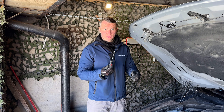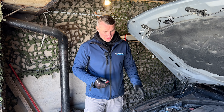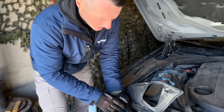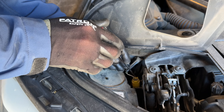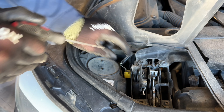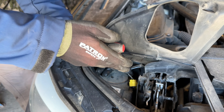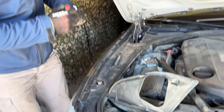Tools you'll need: gloves to protect your hands and a small screwdriver. The four pyrotechnic cartridges are located in the front light area on both sides. You can see the yellow plug — there's a small clip you just unclick, then remove the plug. After the job is done, insulate those plugs to keep them clean. Since there were no errors with the pyrotechnic cartridges, they are working fine.